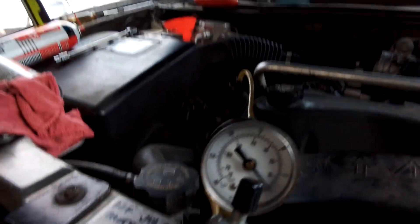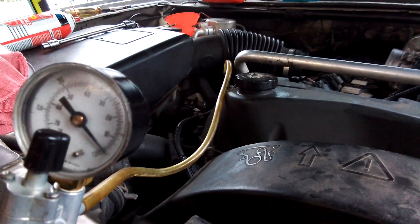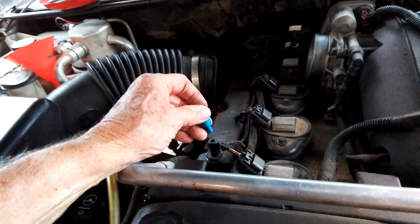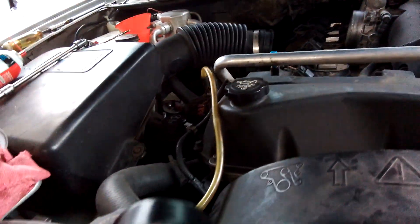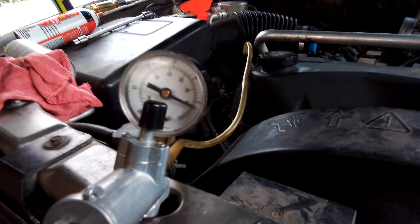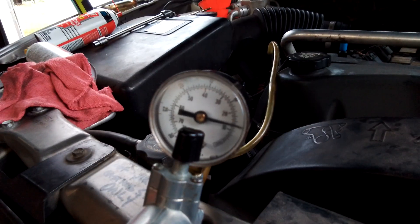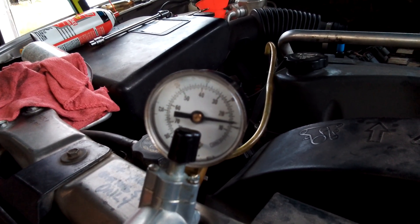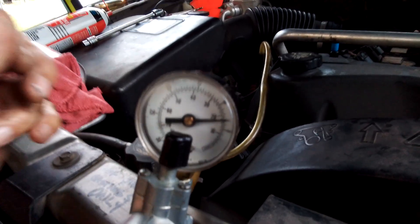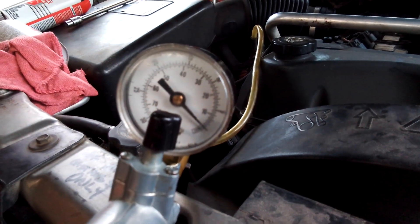Let's get my fingers out of the way. I've got this little plastic cap with a funny little nipple on it. I'm going to put it right inside this thing here and plug it off. The gauge is going off — there's 10 inches of vacuum. We've got about 14, 15, 16 inches of vacuum and it's still coming up. Before it gets stupid, I'm going to go ahead and pull this plug back out. You can hear the vacuum leaking back into the system.